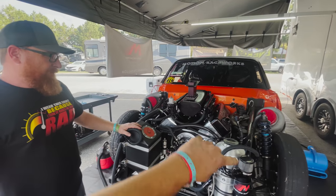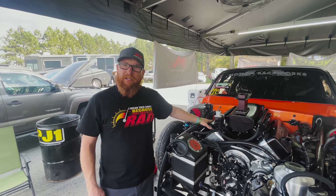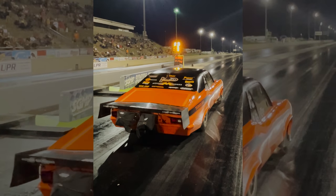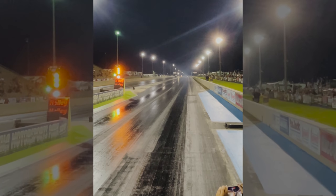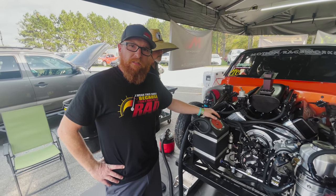It's basically drawing cool air across all the components of the engine pretty evenly. Yeah, and it also helps to pull any kind of moisture, because we only run these things down the track at like 115 degrees. Sometimes it doesn't even get hot enough to burn the moisture out of the oil. And by doing that you're also avoiding having water leak and dripping everywhere.